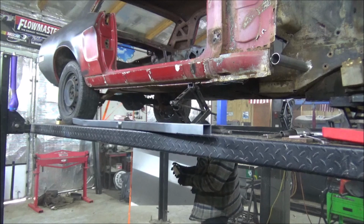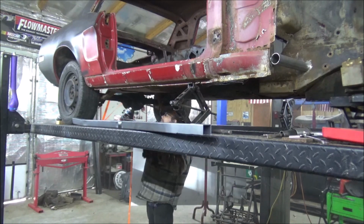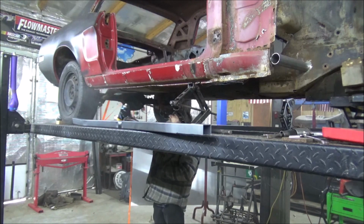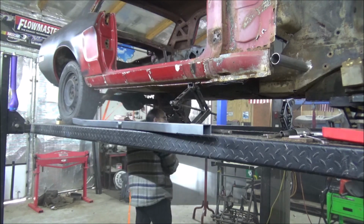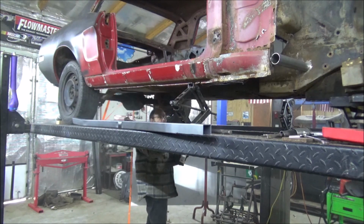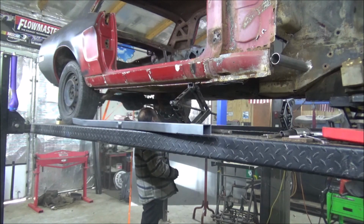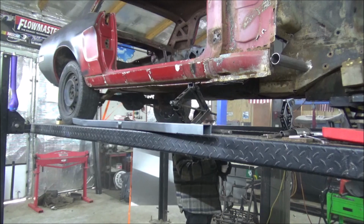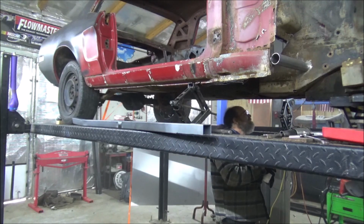It's also right here where Casey done all that grinding. We want to get that. Don't forget to shoot it through the front frame as well. Forget what? You want to shoot welding or etching primer into the front of it? Welding primer up in there too. Because if I use etching primer up in there, you won't be able to weld. It all just melt away. More likely.